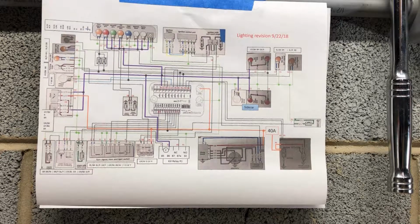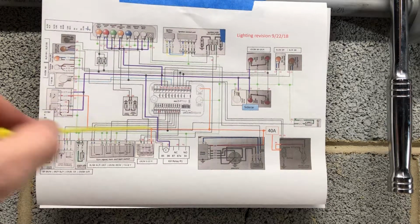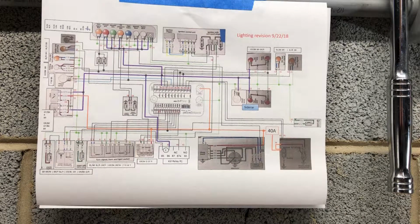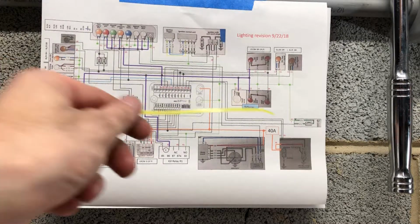Now, the only thing I have to really verify is that the charging system is hooked up correctly. Pretty sure it is. I actually had the bike up and running on idle today. When I first ran it, it was really running hot, so I shut it off pretty quick. Then I changed out some leaking vacuum lines. I backed off the idle adjust screws to make sure it was running a little bit on the rich side, and adjusted the timing. I think maybe my timing was a little bit on the retard side versus the advanced side.